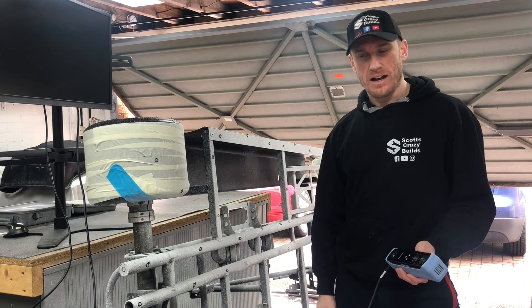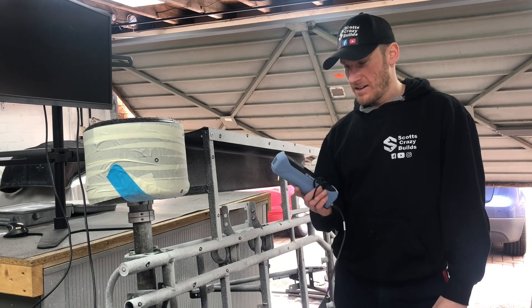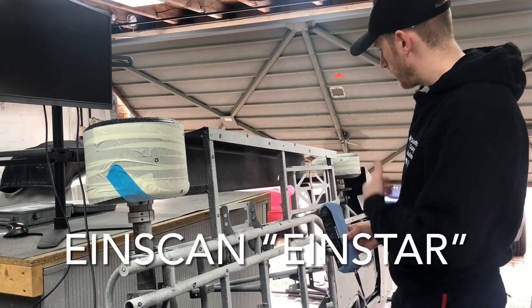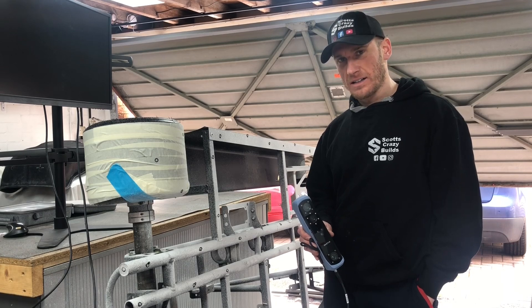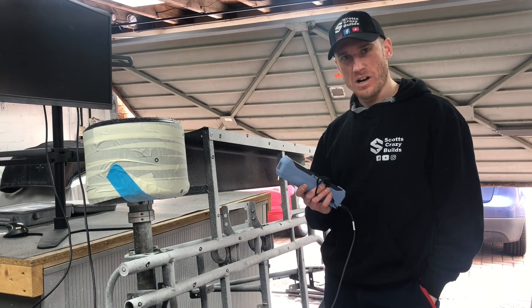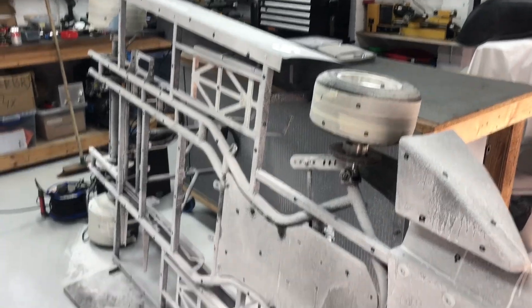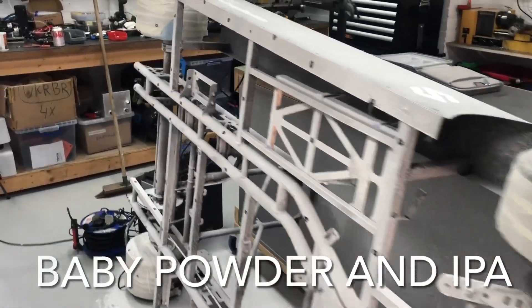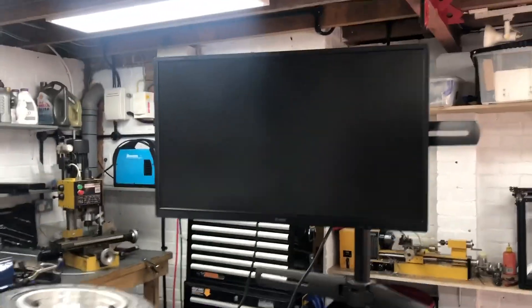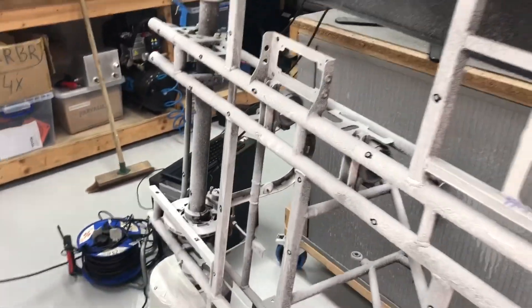Hello and welcome to another video. Today I'm going to attempt to use this new fancy bit of kit — a 3D scanner — to scan the car floor, because I need to produce a new aluminium floor and I want to get the dimensions spot on. To prep, I've sprayed the car with baby powder, which apparently gives a good matte white finish that you can brush off easily. I've got my PC set up and stuck reflective dots all over it, which gives the scanner reference points. Let's give it a go.